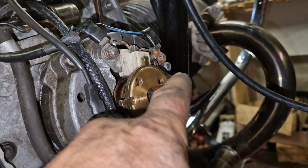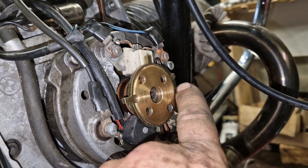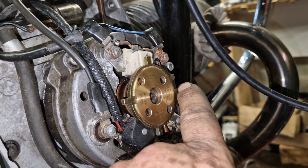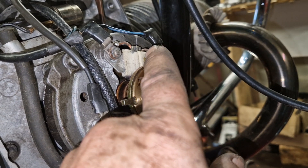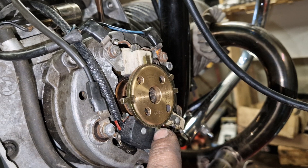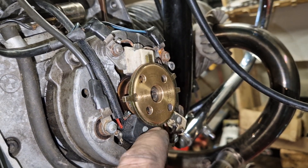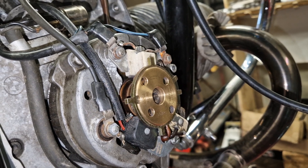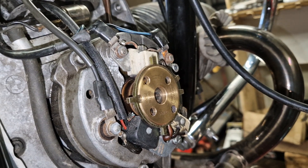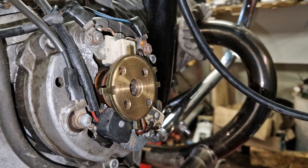And this brass rotor, which also goes with the standard bolt on the charger. Since this has a lot of signs, it will actually give a double pulse, telling that now the rotation is coming. And then it takes two, three, and on the fourth it puts the ignition on. This means that you could use this even with a kickstarter, because you need typically like one and a half or two rotations max to get your ignition timed.